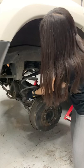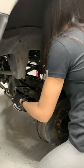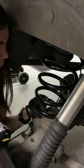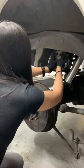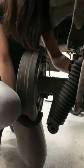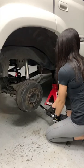It was a lot easier to take out after that, but the harder part was putting the new stiffer spring in, which took a few tries, but eventually I managed to use enough strength to put it in. Then I was putting everything back together, starting with the bump stop, sway bar mount, putting that lower shock back in, and torquing my bolts to spec.